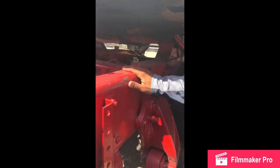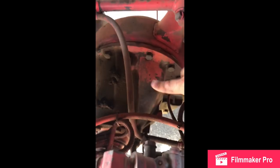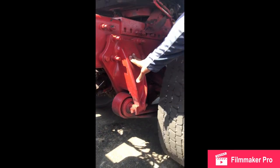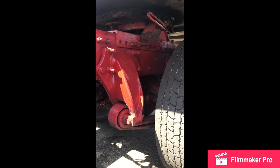My drive axle and rubber seal: no cracks, no breaks, no illegal welds, always in the straight position, good rubber seal inside, fluids always full, mounted and secure. My spring mount: no cracks, no breaks, no illegal welds, securely mounted with nuts and bolts, mounted and secure. My spring leaves: no cracks, no breaks, no missing leaf springs, no illegal welds, always in the straight position, securely mounted with nuts and bolts, mounted and secure. My spacer: no cracks, no breaks, securely mounted with U-bolts, mounted and secure. My U-bolts: no cracks, no breaks, no illegal welds, securely mounted with nuts and bolts, mounted and secure.